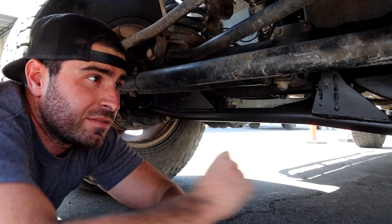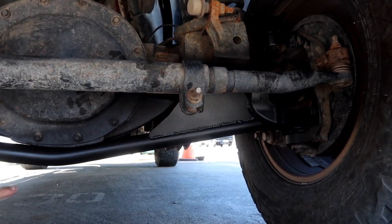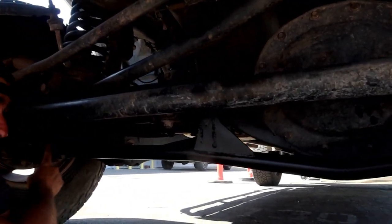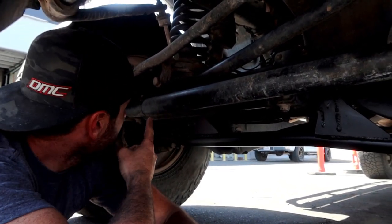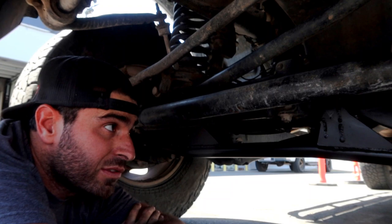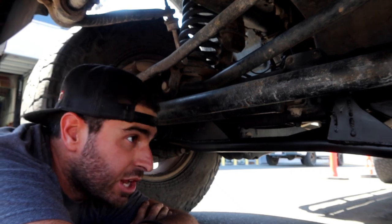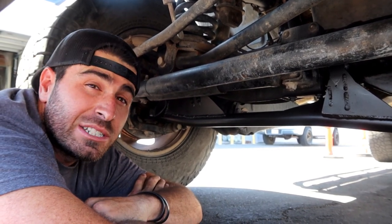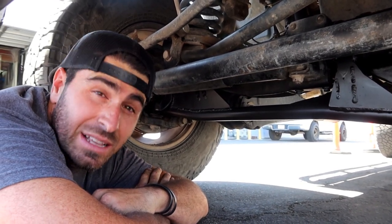We got this project all finished up. You can see the truss extends all the way from the driver's side outer C, comes all the way across underneath the diff where it's welded on the backside. We got gussets all over the place, and on the upper side there is a little support to the coil bucket so it's nice and strong overall. It was a pretty quick project — took about three hours, including cleaning it up, taking the tires off, putting it all back together. We also threw some new brake pads in since we had the truck up and it needed them. Overall great project — if you're looking to take your truck off-road, this is something you might want to consider. Thanks for watching guys.